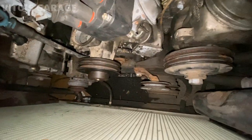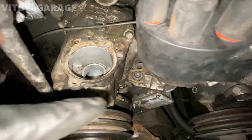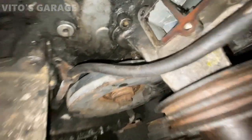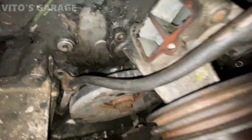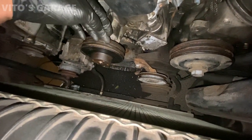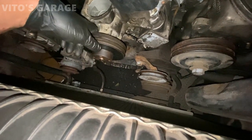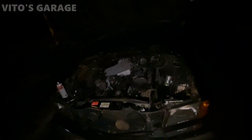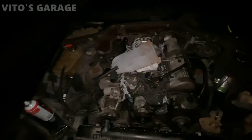Look at that — corroded. It's late at night and this is how far we got. I actually had to remove the distributor as well because there was one bolt I couldn't get to. The water pump is still on because we have to remove the harmonic balancer — the bolt on the bottom has no clearance because of the balancer. Because of that long bolt you have to take the whole thing out along with the harmonic balancer. We've been cleaning a bunch of stuff and prepping new parts for the installation.